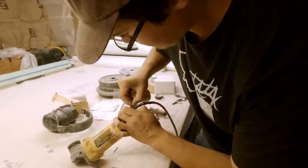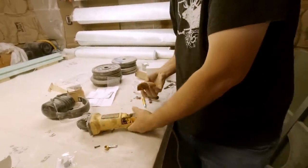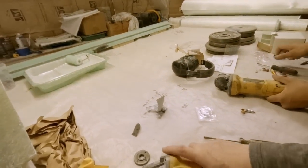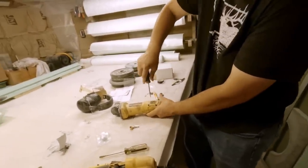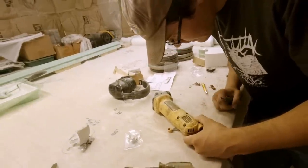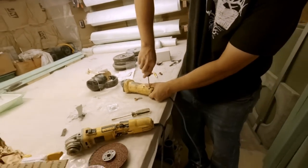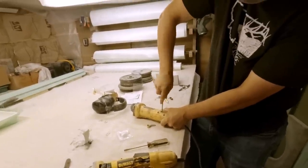He's ready for his grinder - that's why he wants it, for production. I actually miss this one because the locking mechanism for the arbor is different - this model has it on the top and the other one has it on the side. That one is old - 2008, there it is. So we got some mileage out of that baby. I think that's the one we probably replaced brushes in before, and apparently did a cord repair too at some point.